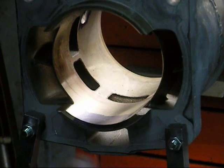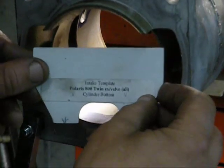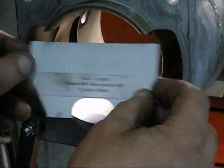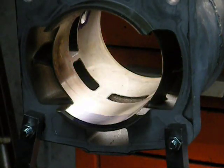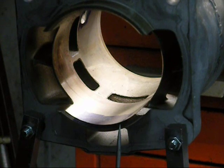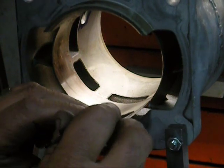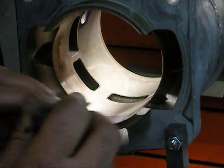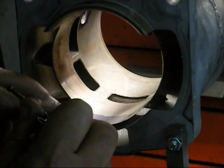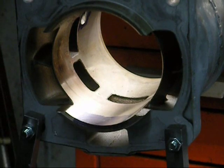I went ahead and cleaned the cylinder, same thing we did on the exhaust side — applied it, put my template in. This is what the intake template looks like, and what we're going to be doing is removing part of the skirt itself. To double check alignment I used a set of dividers. Once I scribed my line, I check on this side and again on this side, and make sure that everything is centered and everything's going to come out the same.